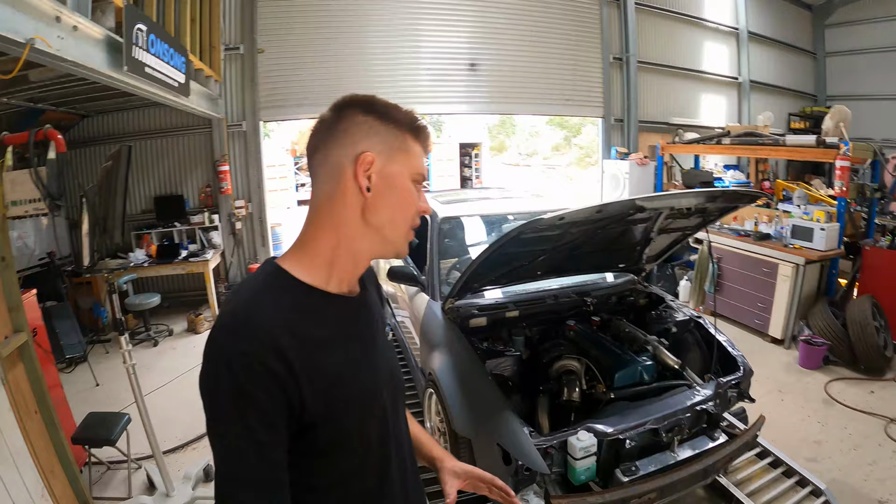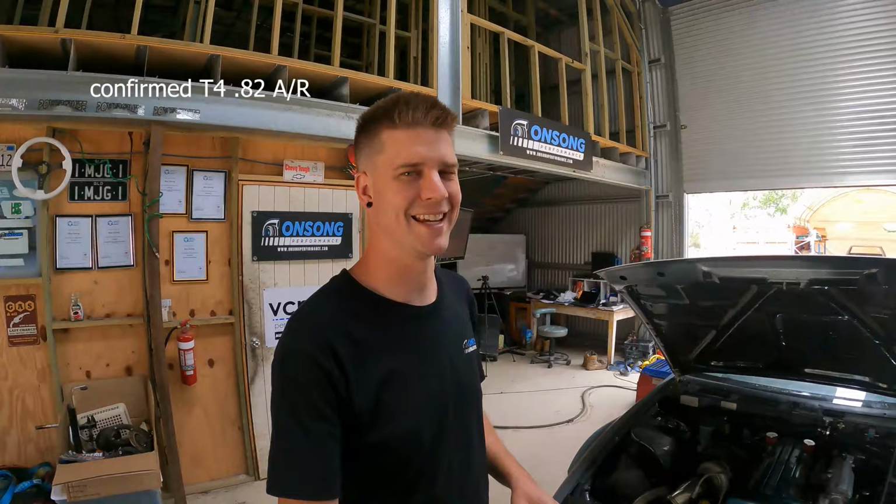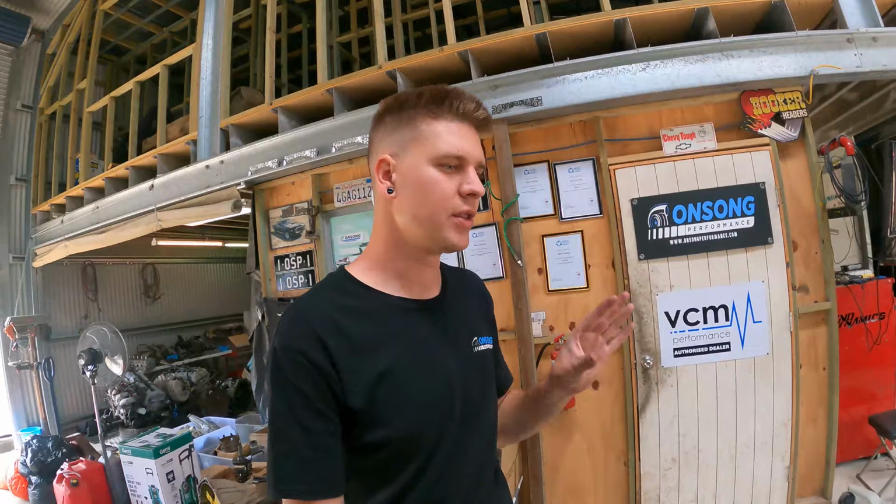So this is just a stock VVTi 2JZ-GTE. We've got a Mamba 3582 with, we believe, a 0.8, I'm pretty sure he said. It's been a little while since he dropped it off. I'll have to talk to him because I've been sick. Anyway, Bosch 1000s, R35 coils from Golby's. Pretty much rounds out the combo. Just about all of these boys, the combos are very similar. They're usually just JZs, 1000cc injectors, R35 coils, and we're good to go.